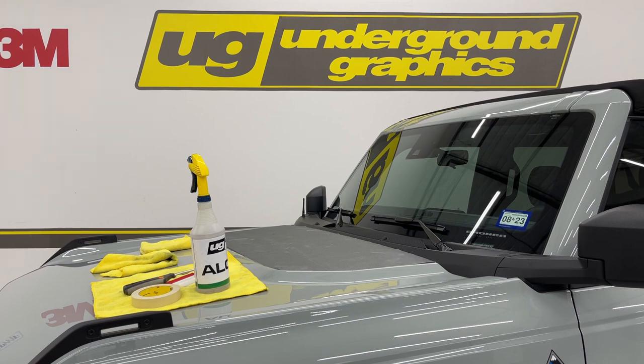This is going to be one of the easiest installs to do. These are already cut to fit. The only thing you're going to need: clean the hood, make sure you install this on a cool dry hood — don't do this out in the sun, don't do it when the car is hot. We're inside at 72 degrees. You'll need some alcohol to prep the surface — we use an alcohol-water mix — a squeegee, which will be provided. Remember, a hard squeegee is fine on the mask, but if you're going onto the vinyl itself, wrap a microfiber around that edge. You'll also need masking tape and scissors. You really don't even need a ruler.